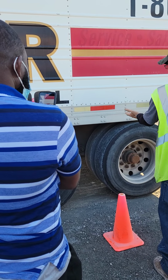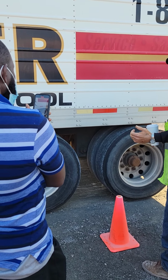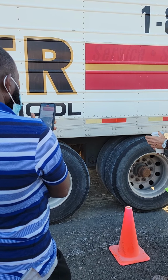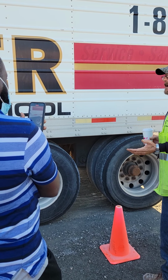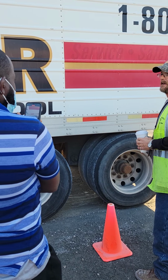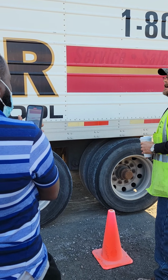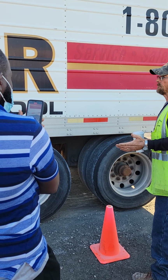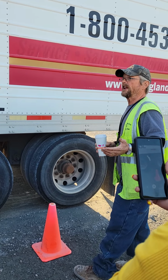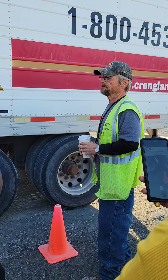I got like a box with a bolt. That's my front control arm mount with control arm with bushings. There's no U-bolts. It's welded to the axle. But you do have airbags and shock. Okay, not cracked or broken, mounted and secured. Airbag, and I'll say it again. Not ripped, torn, frayed, mounted securely, not leaking. And my shock is not leaking hydraulic fluid.